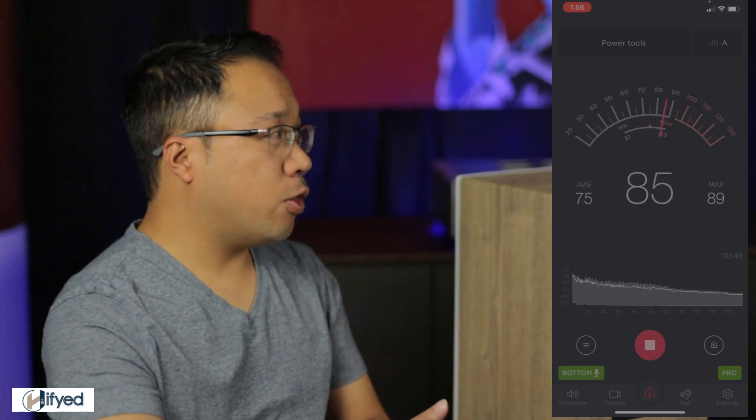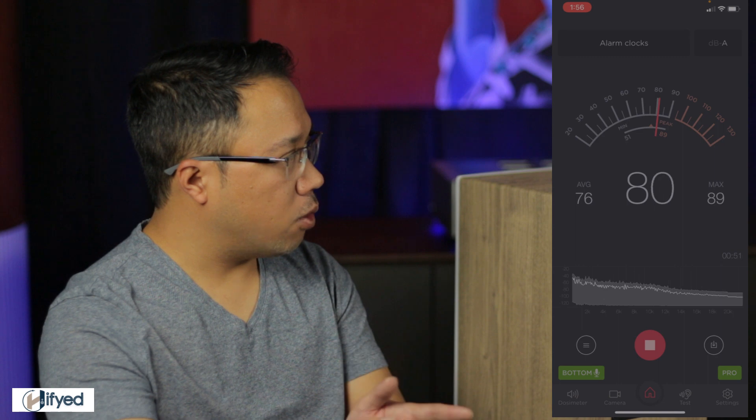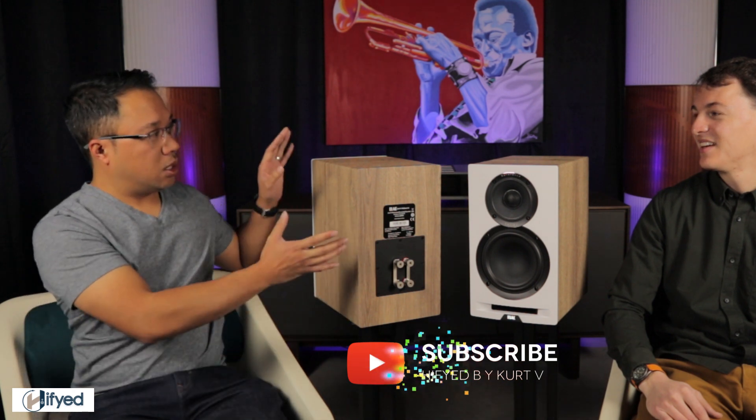We were measuring from about 13 feet away, which is a typical living room distance. To get 84 dB at 13 feet in roughly a 130 to 140 square foot room is quite sufficient. We were able to peak out at 87 to 88 dB, which is getting quite loud. So it's sufficient enough for most rooms under 180 to 200 square feet. It is a bookshelf speaker, so it can only move so much air for really big SPLs.